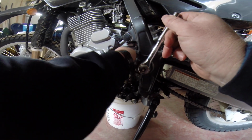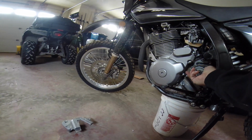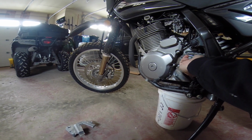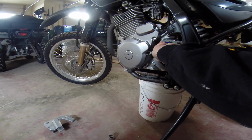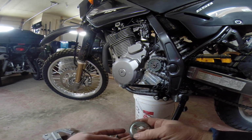I should also have here, guys, and I don't have it with me, a screwdriver. Okay, now you see how I turned that? Did you see that? You have to turn it and then pull it out. Turn it and then... Now I can't do it. So you do it till the splines line up, and then you pull that off, okay? Let's put the bolts back in there.